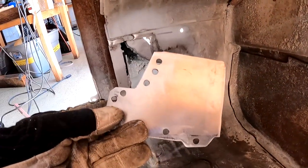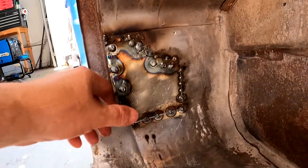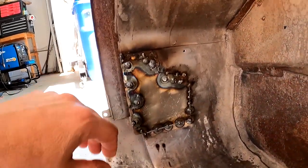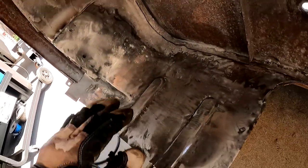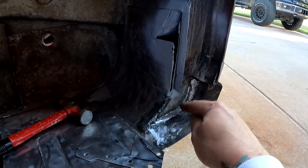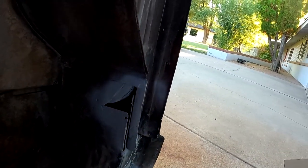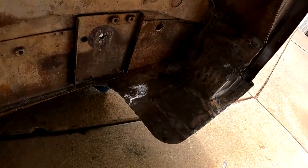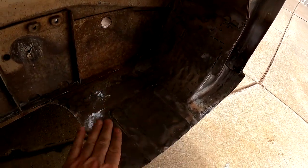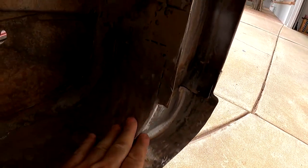I think it's time to weld this guy on. The patch is roughed in — time to grind it down and make it look like it was never there. The passenger side is done for the most part. Need to remember to put in a drain hole. I built this all up with weld and I'm starting to grind it smooth like I did the other side, and I filled this area with some weldable primer and made this patch piece that goes right in there. After a couple hours of work and lots and lots of grinding, I'm really close. I have that corner all smoothed out and this corner all smoothed out to look like pressed bends.